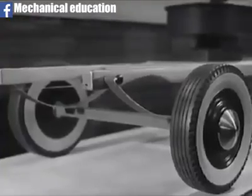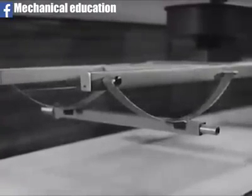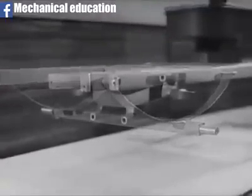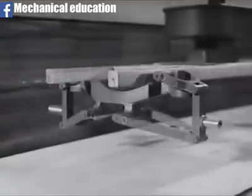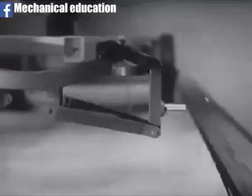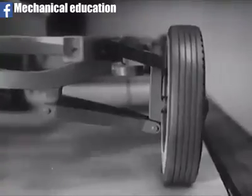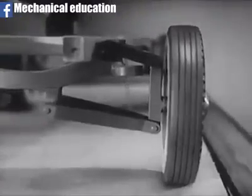The only way to eliminate this unequal springing and make the front springs soft is to give them only one job to perform, the job of absorbing bumps. Suppose we replace the bouncing axle with a rigid, immovable beam. Now the wheels can be fastened to the beam by 2 parallel swinging arms. The wheel is pivoted so that even when the arms are tilted by a jolt or bump, the wheel remains vertical and in perfect alignment.